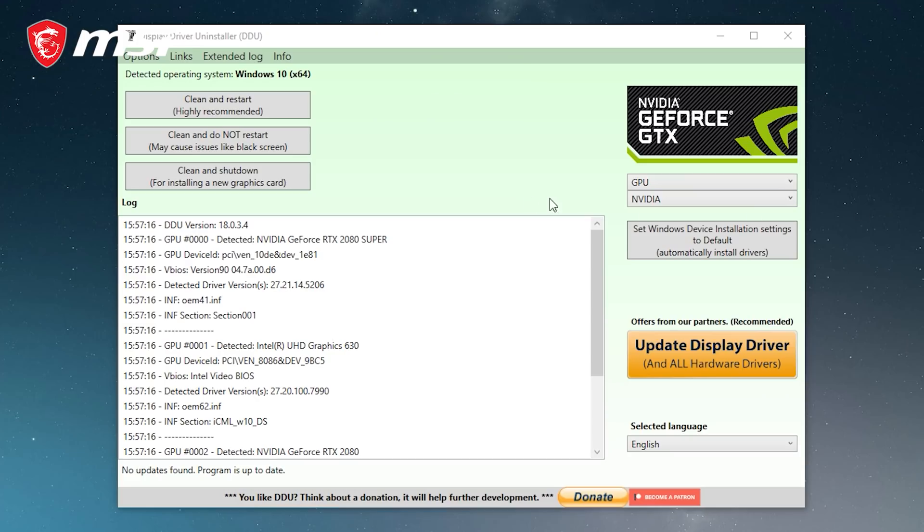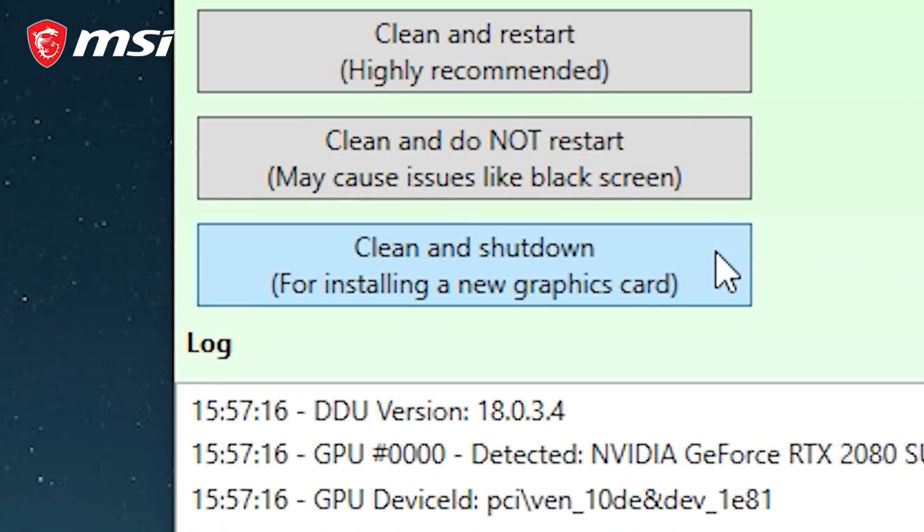The surefire peace of mind solution is to completely remove any trace of Nvidia drivers just prior to the hardware swap. You could do this manually, which would take some time, or you could use a program called DDU which has a one-click solution for upgrading graphics cards. This button here, which should say something like 'clean and shut down,' is the one you'll want to click. It'll wipe any trace of current drivers and shut down your system, at which point you can swap cards and power back on. From there, navigate to your GPU manufacturer's download page and download the necessary file for installation.